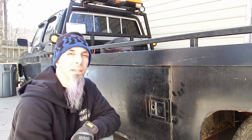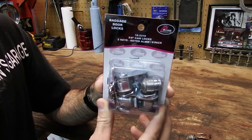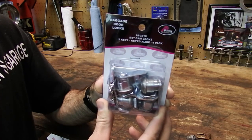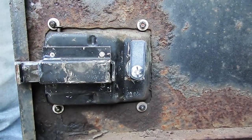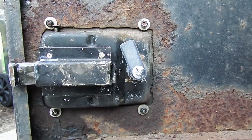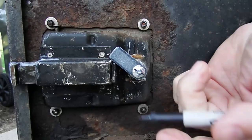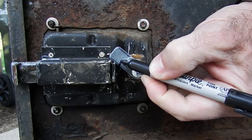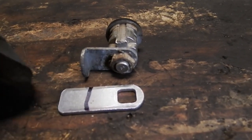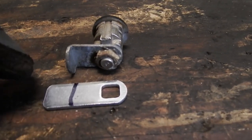This one closes a little weird because it's heavy and the hinge needs to be replaced. But we got them all opening and closing. So let's check out those lock cylinders. This is what I got to replace them — I got this on Amazon, basically 20 bucks for four lock cylinders. There's two different pawls for each one, a straight one and an angled one, and they come with keys so they're all keyed alike. Looking at the length, I think what they did is just took the end and bent it instead of cutting it. So I'm going to try doing that same thing — if it doesn't work I can always use the other ones.